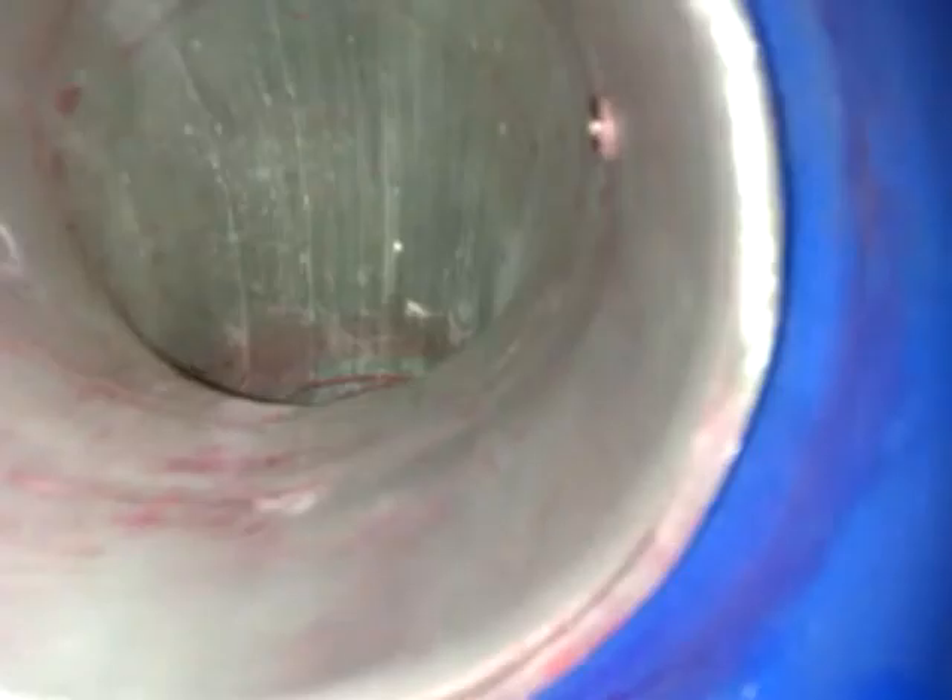Not good. I kind of wonder why — look at that spiral, just getting all sucked in. As you can see, the meth is actually moved up way past where the nozzle is supposed to be. So I wonder what's going on over there. Could be some compressor surge going on, because I am surging wide open.